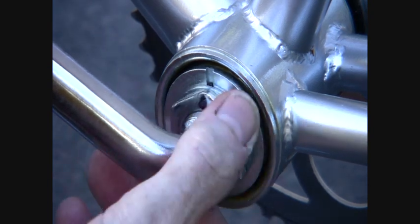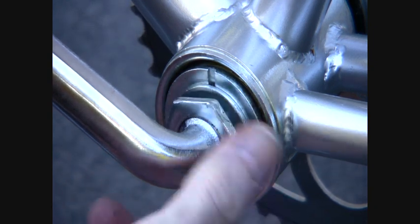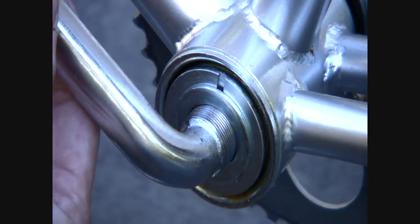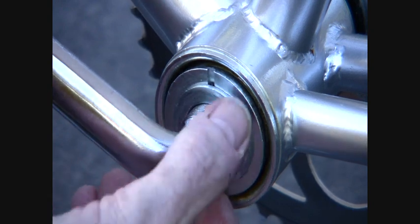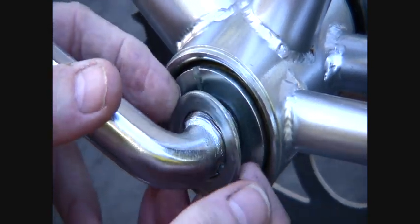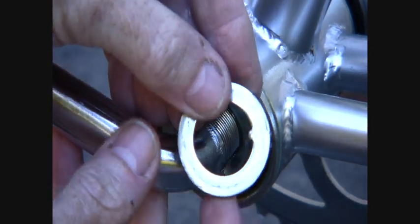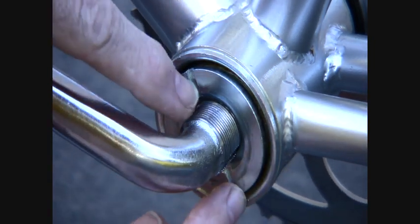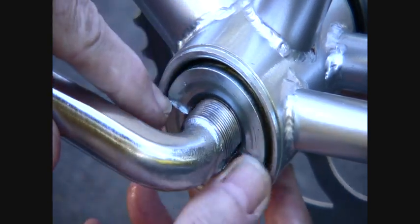I'm doing this for the first time. I did this once before on my old curry bike, but I don't believe it had a left-hand thread, so these things may be variable. There's the nut — we'll just put that on the ground. What remains will be... I'm learning with you. This is my keyed washer — keyed in the sense that it has a little tang so that it can't spin. Then this thing here is probably threaded. This is the cone. We're going to unscrew it.